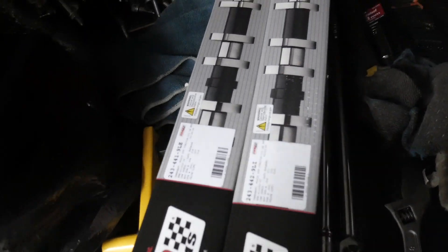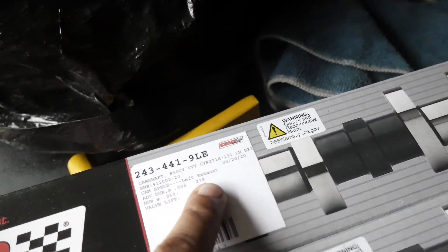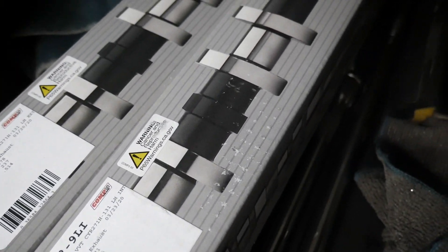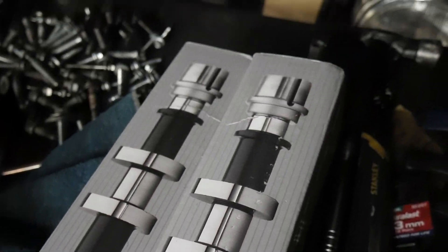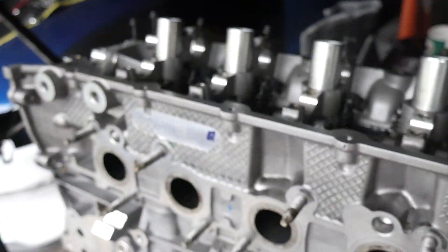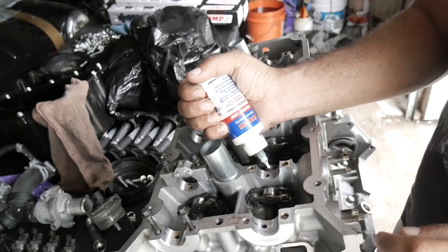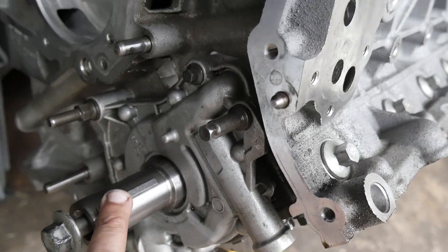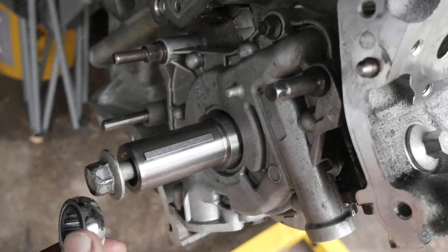Here are our Comp Cams. You can see all our specs here on this — this is our left exhaust. If you were to ask me what any of this stuff means, I have absolutely no idea, but Drew does and Comp Cams does. These don't require us to change out any of our springs, any of our lifters or anything like that. So we're gonna go ahead and drop these in. Like with everything, it always says to lube it real good. This here needs to be in a 12 o'clock position, so let's go ahead and rotate this puppy around.